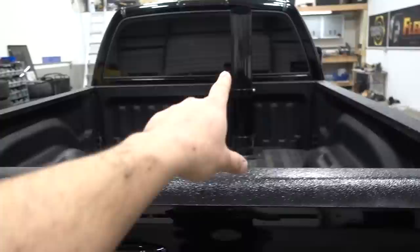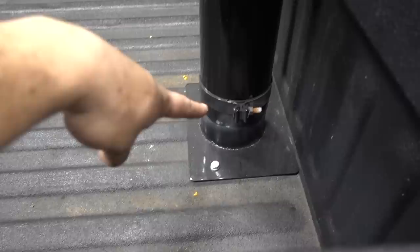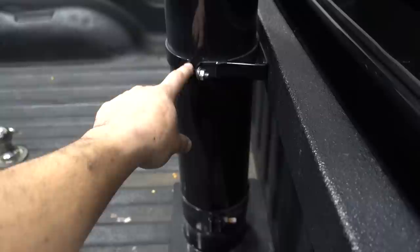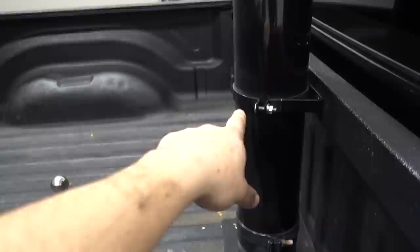I get a lot of questions about the stack. This is an FTE diesel stack and stack kit — their base plate is flanged on the bottom and top because it shoots through the bed. Really nice, clean look and easy to adapt underneath the truck. The clamp is actually a Grand Rock stack clamp — made for a big rig — with studs that poke through behind. It keeps it from shaking around and gives a really clean look.